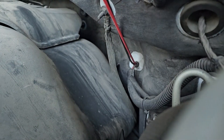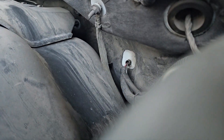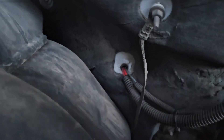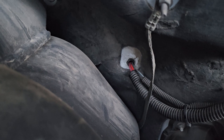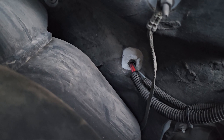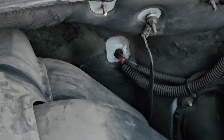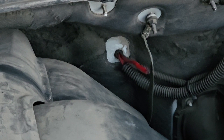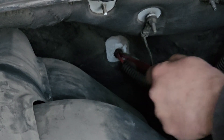Pull out the old wire and hope and pray there's enough room for a 10-gauge wire to fit in there. Prayer's not answered — that pair of 10-gauge wires isn't going in. So I will run the positive wire out here to the positive post and attach the negative wire to the firewall somewhere on the inside. First try — that you saw anyway.